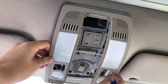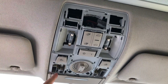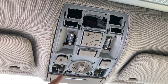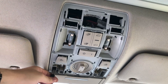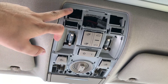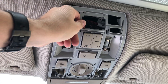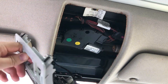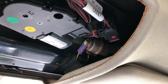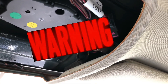Then slowly continue prying this off like this. Use a screwdriver for the screws right over here — in my case they are Phillips head. Remove them, and then there are also clips over here and over here that you just have to nudge and it comes right off. Then on the inside you can see your igniter right there with that clip.